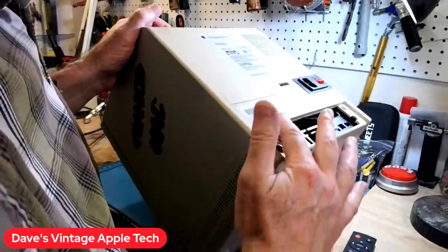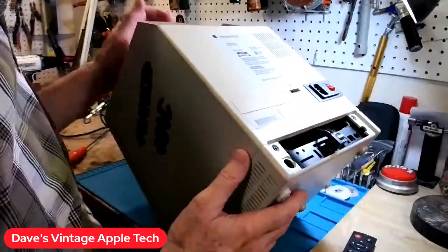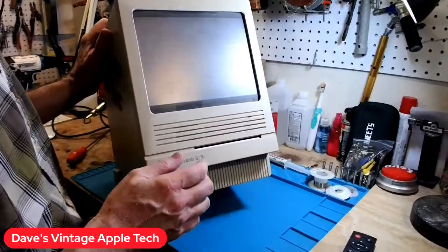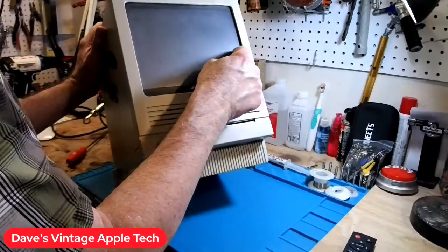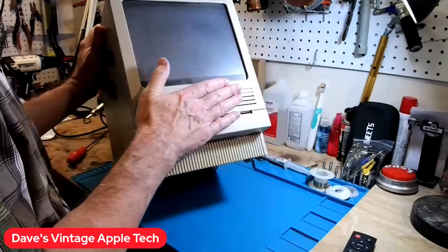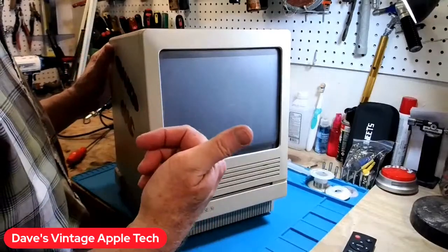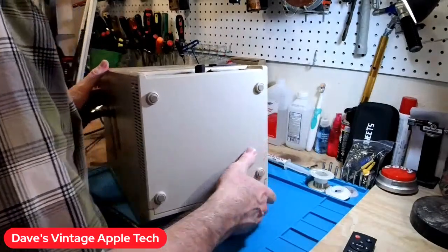Obviously, I had to blow the I/O port out of here because this thing is mounted in here. The other thing I had to do was mod the switch there. And then the main thing that I had to do, and this is nice and light actually, it's like 5.5 pounds. And you can really see the anti-glare there. And I had to elongate this bezel. On the CRTs, that bezel went in a little bit and it curved down to accommodate the picture tube. So what I did is I cut that out to flatten this out as much as I could to put this widescreen in it. And that's a 10.1 inch LCD screen. It's got a variety of connectors on it, but I'm using the HDMI on it because that's what I wanted to do.